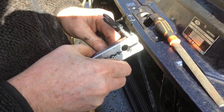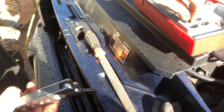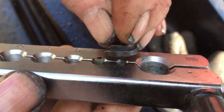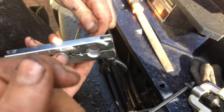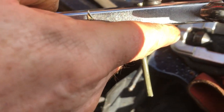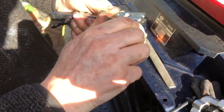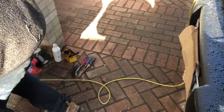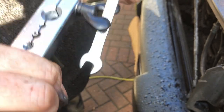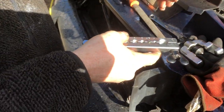You may know how to use this flaring tool, or you might not. Position it in there, do it real loose, and make sure you've got the right die. That first collar needs to be the same height as the pipe end - you can tweak it up and down. Put it in the vice so you can hold it, keep everything together without moving around. Ideally put a spanner in there and tighten that up. It's important the pipe is very well gripped because when you use this press tool you don't want it slipping down.